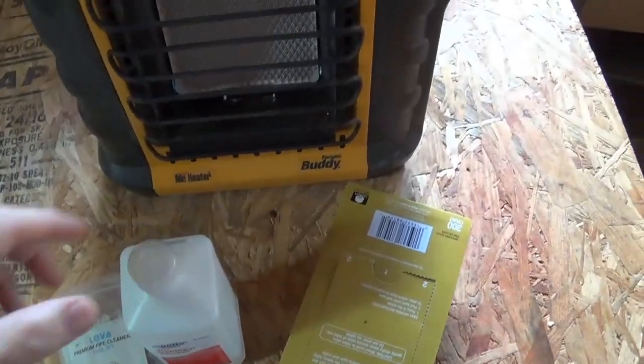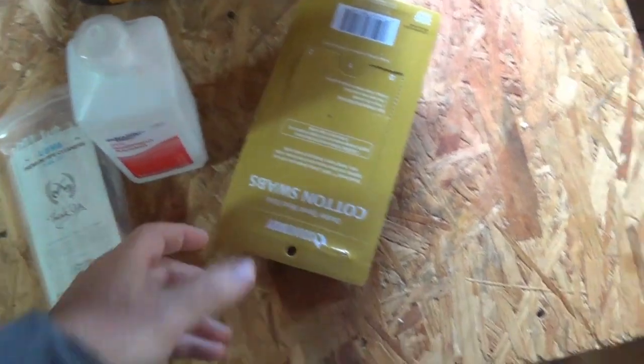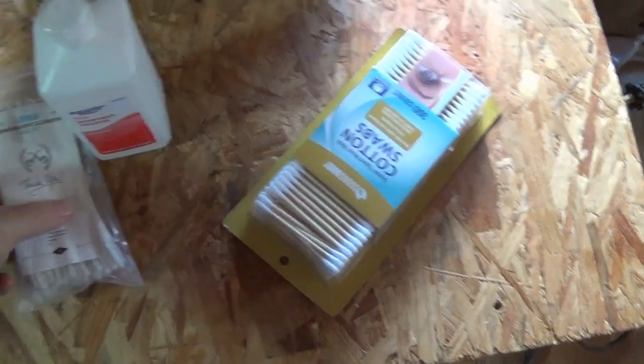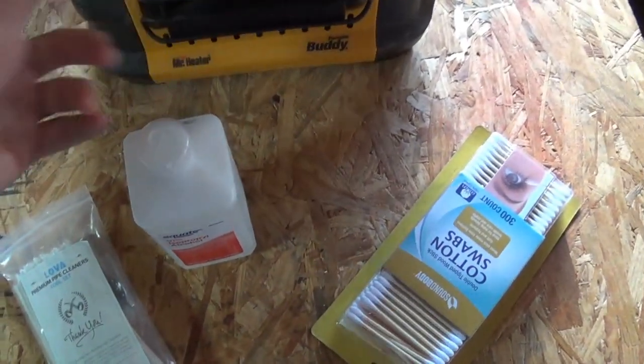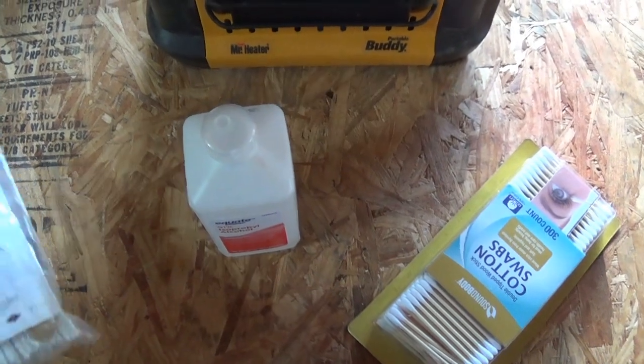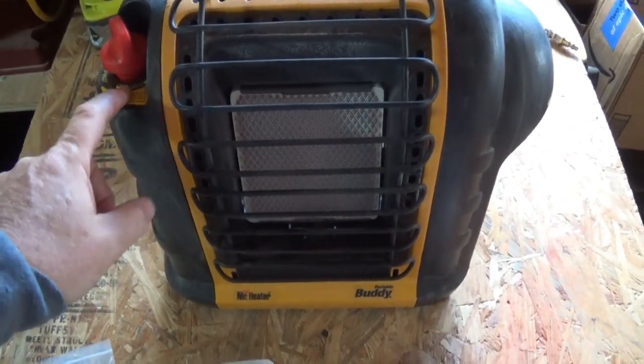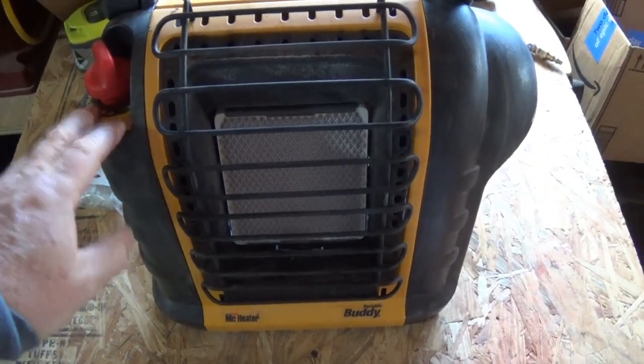Today's video, we're going to tear down a regular buddy heater because it won't light, won't ignite. So, let's take a look at it. All you get is a spark and nothing else. I had my alcohol, and I used this down in the orifice and nothing. So, what I bet has happened is I used the wrong hose and there's oil in the fuel line. So let me show you the oil in this.